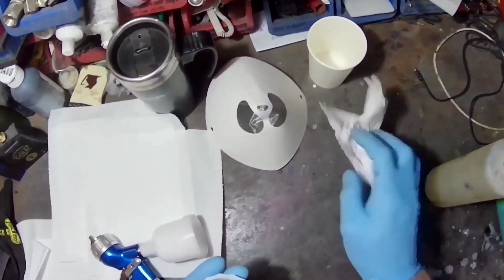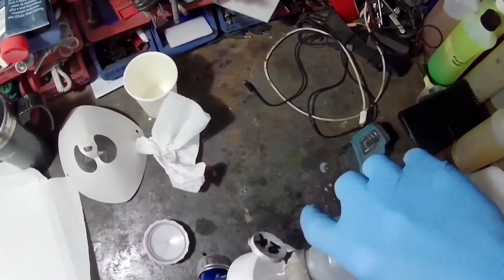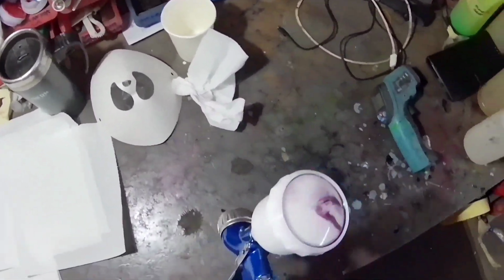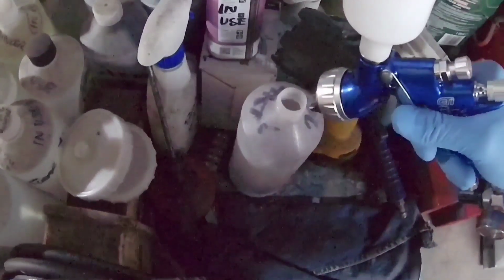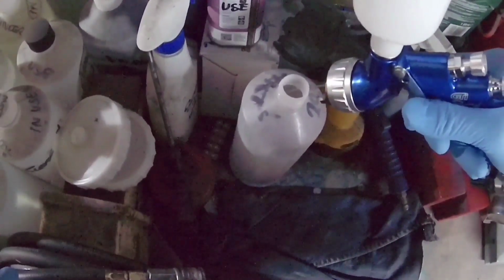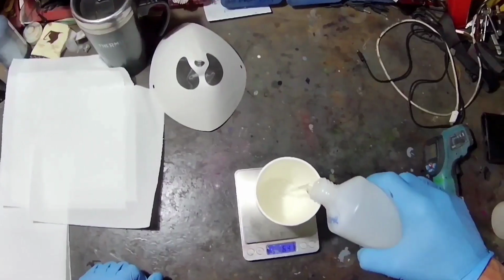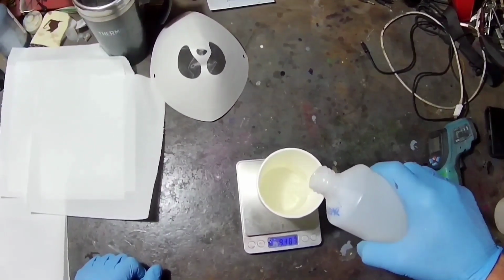So it's relatively expensive. It's not as dear as some of the really expensive ones, but it's not a cheap clear coat. And the reason I use that is because it flows out really nice, holds its gloss level very, very well, but it suits finer atomization. All the better quality clear coats tend to suit guns that have finer atomization, because you're firing very small little particles, and if the clear coat isn't up to flowing out really easily and nicely into each other, you've got to put a lot of those little particles down to make enough of a build-up for it to flow out with the cheaper clear coats.